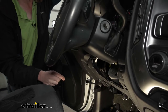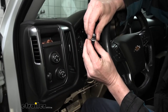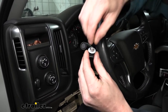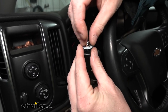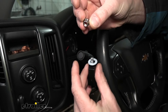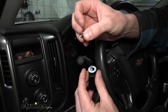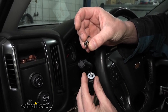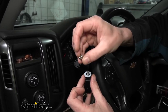Now we're going to get our switch installed. We'll take the knob off — here's our nut. This is the size hole we need to drill so our nut can pass through. This is 10 millimeters, so you'll probably use standard drill bits. The closest size is three-eighths — it's ever so slightly smaller, so you might have to step up just slightly if it's too tight.